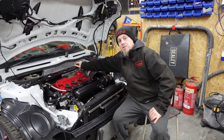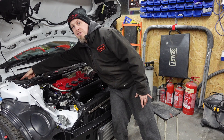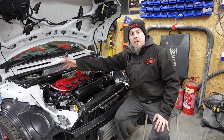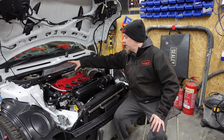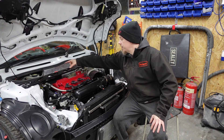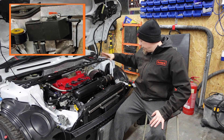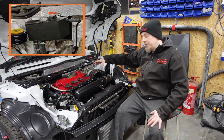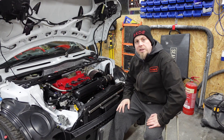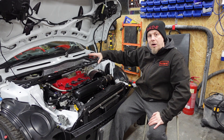There are a lot of different ways you can do this. I've seen certain companies take the power steering tank and locate it over into the location right next to your brake booster — obviously in the US you're doing that on the other side of the car — and then changing the pipework to run it down to the bottom. For the coolant tank, some people like to move it over to a standard location, some bring it to the front, and some like to fit the Cooper header tank where they can find room.